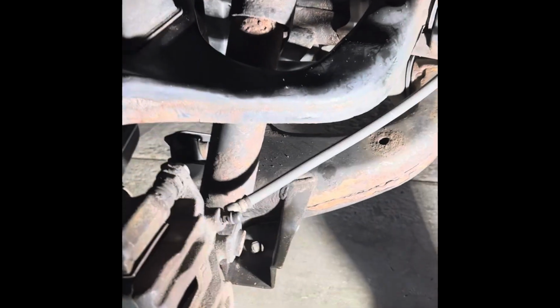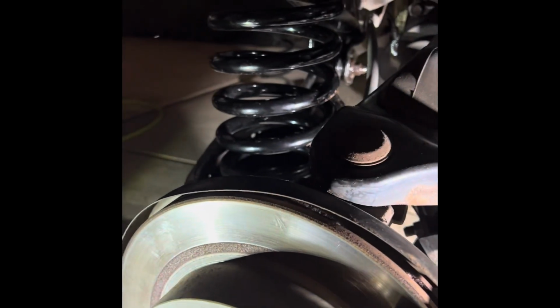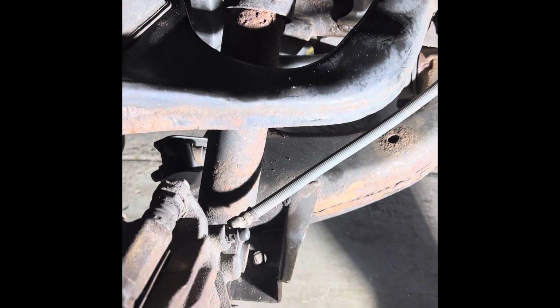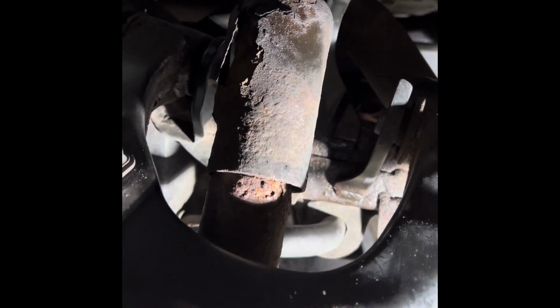All right, another lesson. Make sure the spring is in either the new or the old one when you replace the shock, because it gets really tight, especially up there when this is all compressed up into the top. So tip number whatever. Well, that was exciting. Tough getting any wrenches in the top there.